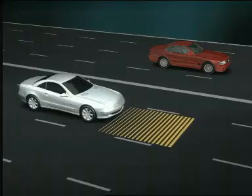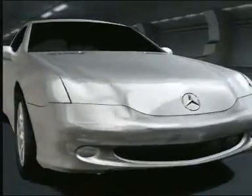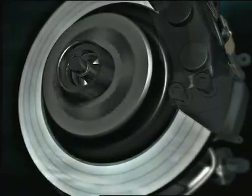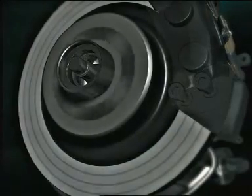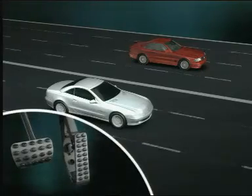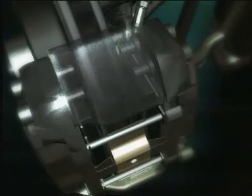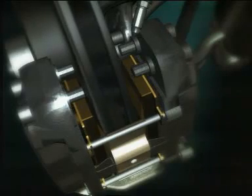The process is also supported by the brake assist, the new dry braking function, and by the pre-filling function. If the system detects wetness, the dry braking function increases brake performance by briefly dry braking the brake discs. If the driver abruptly releases the accelerator, the pre-filling function prepares the system for emergency stopping. The hydraulic lines are then pre-filled at a lower pressure. The brake linings are applied and the response time of the brakes is decreased.